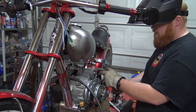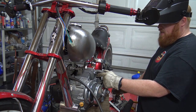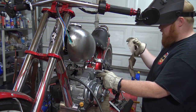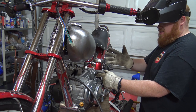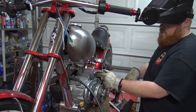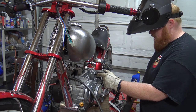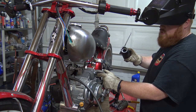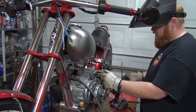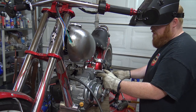I got that all tacked up. If I lay it on the gasket there will be a little gap here and there that I'll weld up — it'll put it exactly where I want it. This exhaust is going to be covered with titanium exhaust wrap and there's going to be a heat shield right there so you won't lay your leg on it. I'm waiting on the adapter that goes from one inch up to the one-and-a-half inch to fit the muffler where I want it.